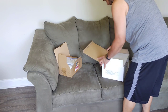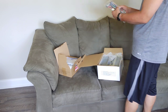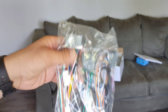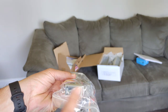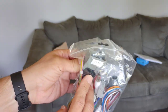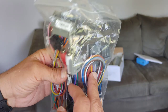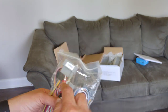This should be the actual 2008 to 2012 Honda Accord installation kit. Here's the wiring harness for the Accord — it's supposed to be complete plug-and-play. The regular plug that's originally plugged into your radio — you unplug that from the car, your car's wiring harness plugs in here, and this then plugs into your factory Honda radio. It jumps the power and plugs into the back of the screen. This plug goes into your factory radio as auxiliary, and this goes into the screen, so when you want to hear sound from your videos or DVDs you just turn your factory radio to auxiliary.